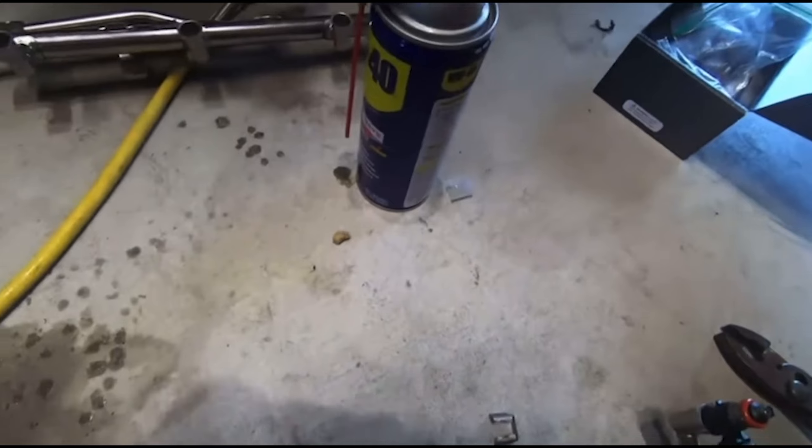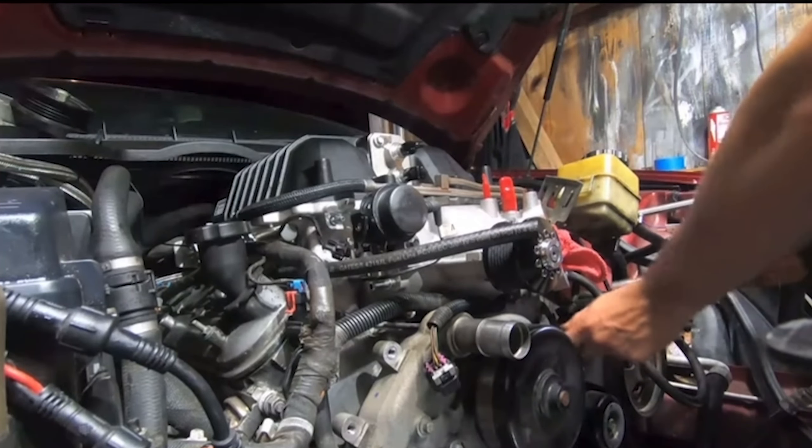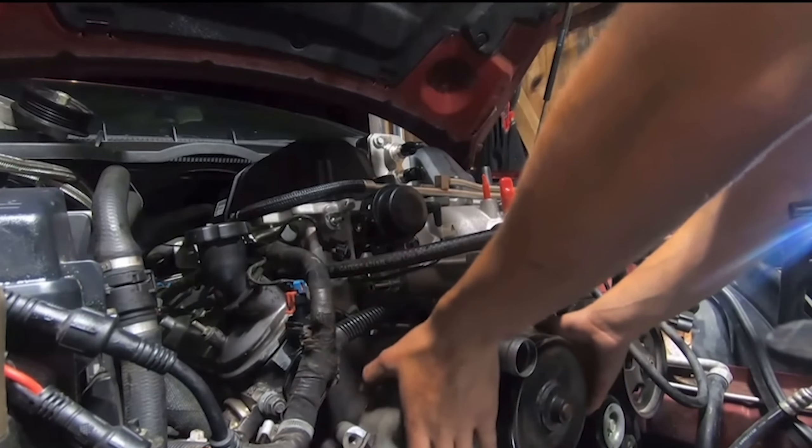Doing these injectors - I got 1050 ID injectors. They're pretty nice; I didn't run out of injector at least not yet. Here we go with the tensioner and water pump. If you don't know, you've got to get a different water pump if your G8 is a certain year - didn't know that until I started installing it.